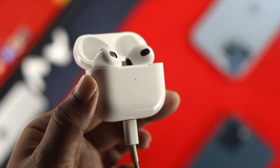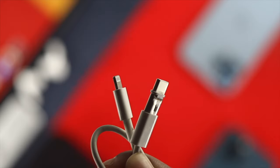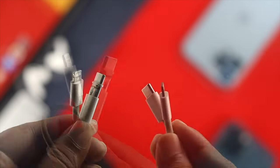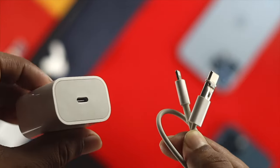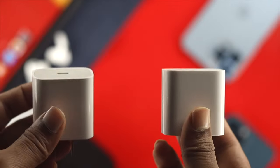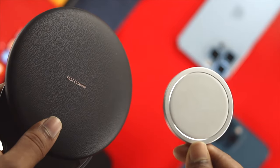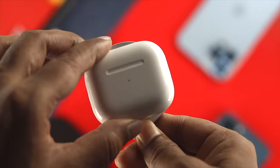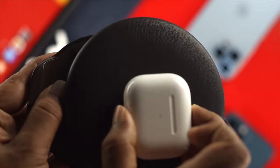There are a couple of things you guys can take a look at to solve your problem. The first way would be changing your charging cable and adapter at the same time to see if that works. If it still doesn't work, the next thing you can do is use a wireless charger — it can be a MagSafe charger or any other wireless charger you might have at home.